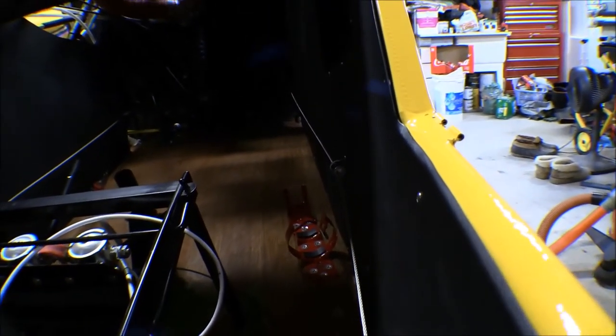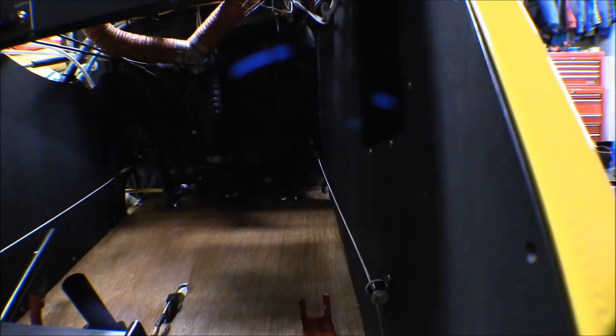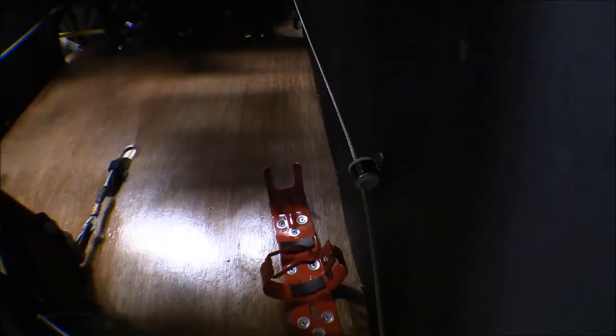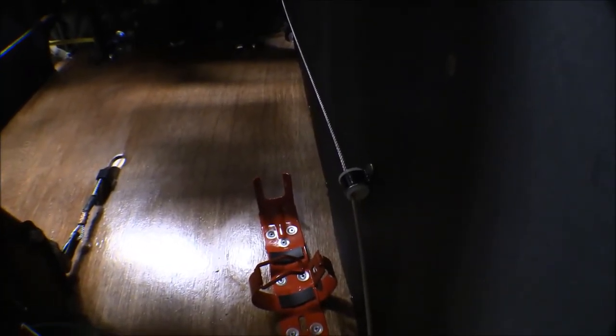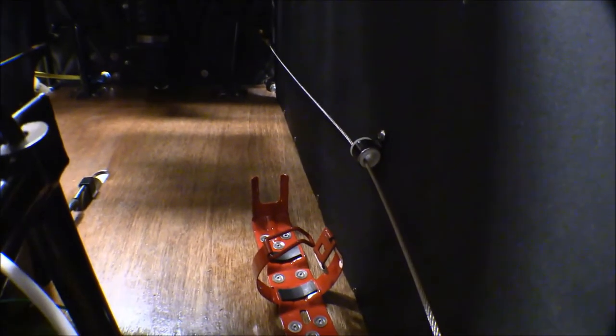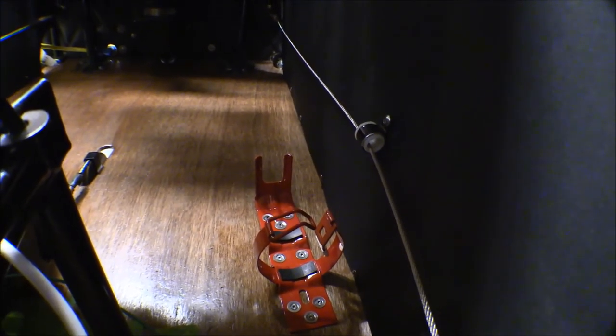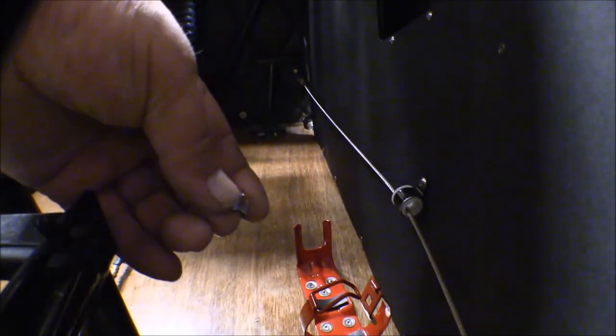So this is where I put it. It's right down here just in front of the pilot seat, and it's back away from the rudder pedals where your feet really won't get to it. I put flat head screws and countersink washers on there just because the fire extinguisher itself will sit up proud of that bottom on those rubber mounts, but that big countersink washer spreads the load out over the surface of that mount.